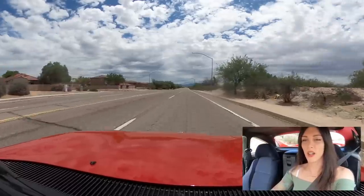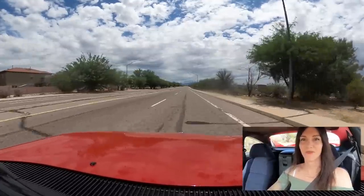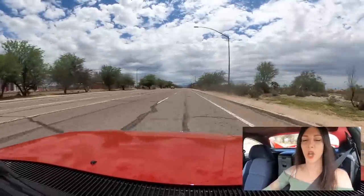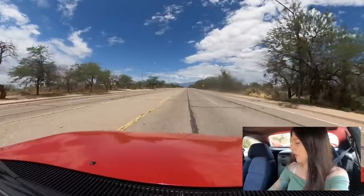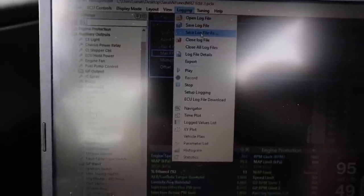It will not build boost at all. Oh — I built a pound and a half. I built a little bit of boost. And now my tach isn't working. That's right, I gotta reconfigure the tach. My AC isn't working again. When I loaded the new map it doesn't have the changes to the tach that I made, because the tachometer adapter I bought also sends a signal up to the AC amplifier to show the AC amplifier that the engine's running — that's why my AC wasn't working before. Temperatures are still good though. Even my air intake temps are down a lot from what they were yesterday.